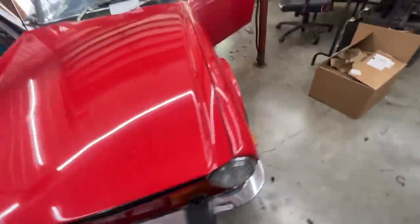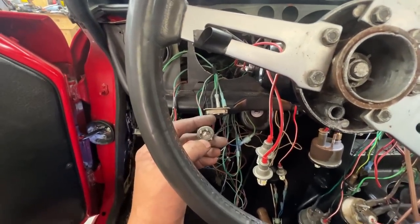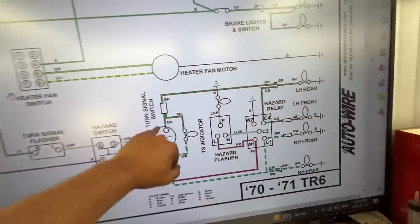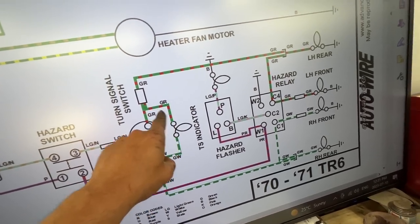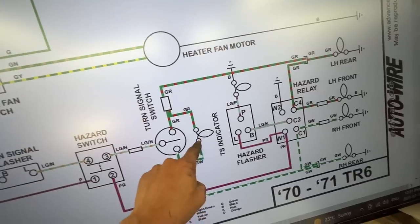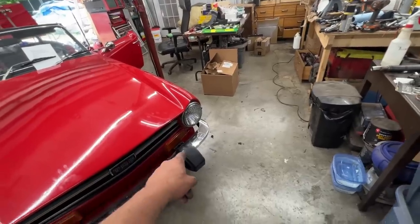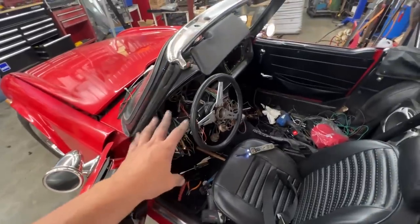The right signal indicator on the dash is not working for that direction — that happens with LED bulbs. When you replace the bulb with an LED it works for one direction only because it's a diode. When the right signal is on, that shoots power to this side, and the other side should send ground through the bulb on the other side. But because that bulb is not connected now, it doesn't see ground through it. So the signals are working properly, it's just slow because only one bulb is actually on.